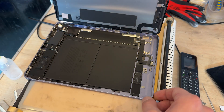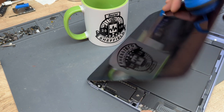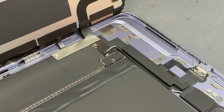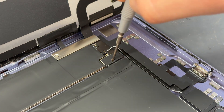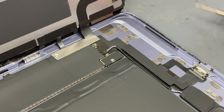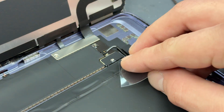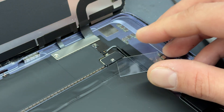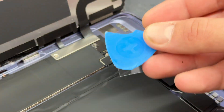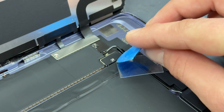Let's go over to the workbench and get this torn down now. Pop a mug behind the iPad to stop it from falling over as we lift it up, and then remove this screw here. It's very important that you do this step — this is the battery connector and power needs to be isolated from the device before you start disconnecting other things. To isolate the power, use an insulated piece of material. I like to use a clear plastic card as it's nice and thin.